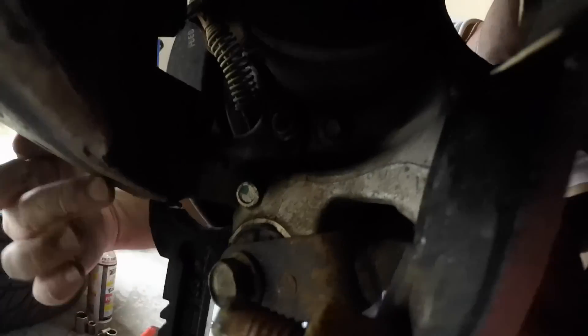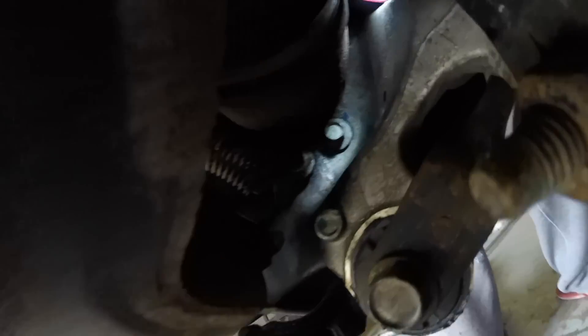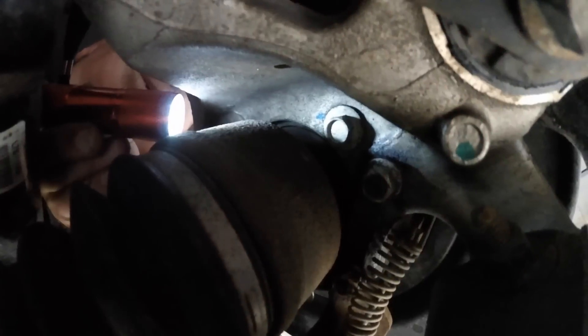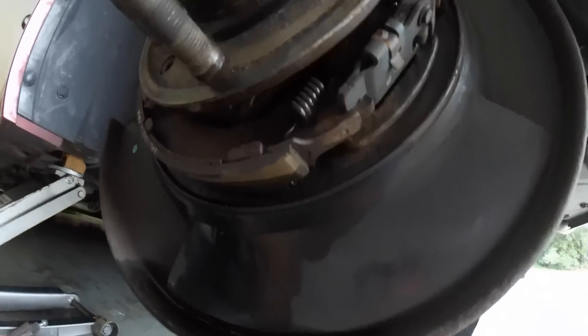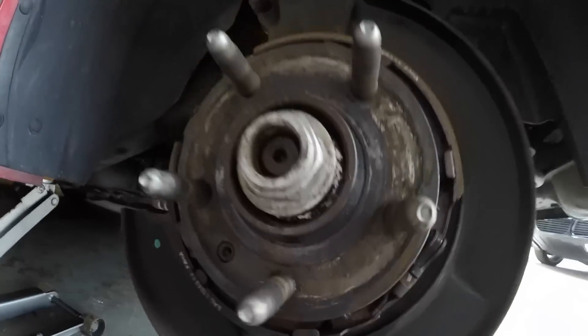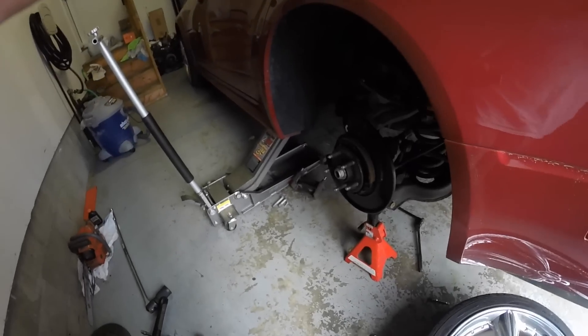I'm trying to figure out some way to get a ratchet back there. That bottom bolt is definitely in a tough spot — a lot of suspension components are going to be in the way. But I got the final one undone. I'll admit I wanted to punch the engineer in the face that designed this because it was not very accessible at all, but persistence pays off. No doubt you're going to need a torch to get those bolts loose — I think they used red Loctite, but the moment I put a torch on those bolts they cracked free right away.